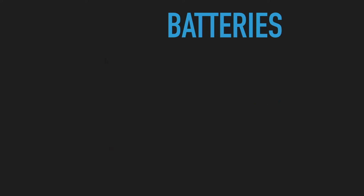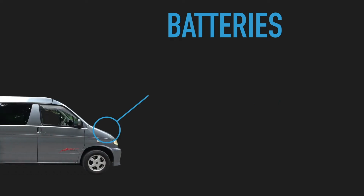But being an old vehicle, the Mazda Bongo alternator doesn't know the difference between different batteries, and it will just take it as a lead acid battery. So connecting any other kind of battery could result in that battery being damaged. So if this is the setup that you have, pretty much the only battery you can put in there is a lead acid battery, just so you don't actually waste your money on buying, say, a gel battery, and it'll basically end up damaging it.